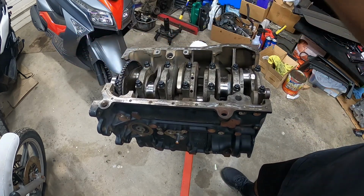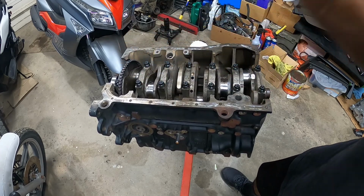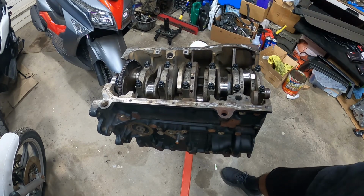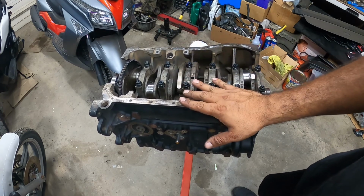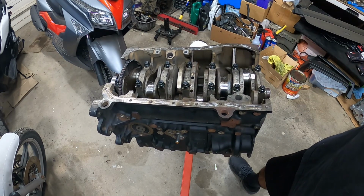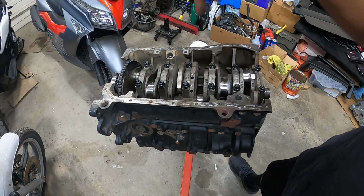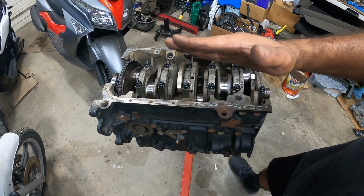All new hardware, new bearings, pretty much forged hardware, best stuff out there. That's how we install a crank. Next time, on the next video we're going to be installing rods and pistons and rod bearings and showing you guys how to properly slap in your pistons, because you need a very special tool to actually put your pistons in these engines, because they're at a 15-degree angle.